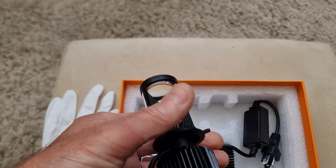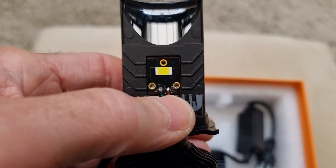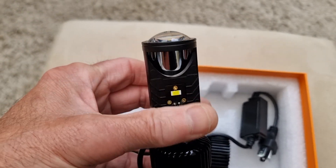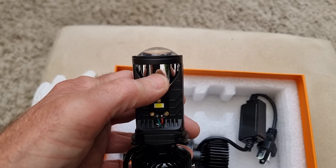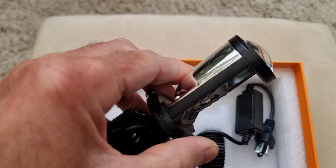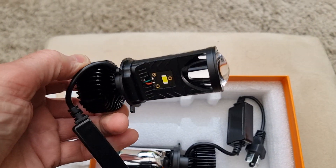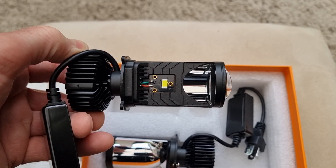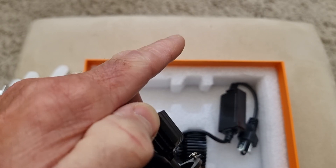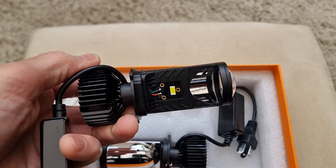I've already taken these out for a quick look. One thing I will say: on my unit there is a bit of a solder splodge on the cable, so just check the connection when you get yours. There's quite a fair-sized lens at the end. I think one chip may be high beam and the other dip beam — there are two LED chips, one each side. There's a fan at the back, and this fan does unscrew, which I'll show in a minute. The only thing I'll say is there doesn't seem to be a way to adjust the beam cutoff, so for right-hand or left-hand drive vehicles there's no way of setting it — which may be a problem.